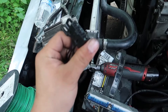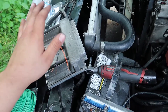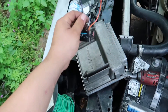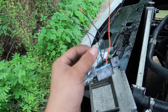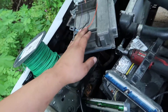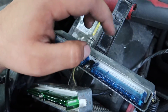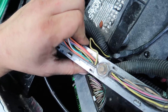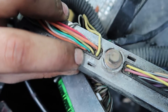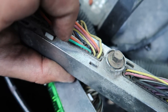To find where the data wire goes to the PCM, depending on what year your LS computer is out of, it's going to be a different color wire. It can be purple — this plug came out of a different car where the purple wire goes all the way to the ECM on pin 58. But this ECM is older; it's the same location. It's going to be the blue connector, C2, and it's going to be pin number 58. This is the green wire — that is the serial data wire.